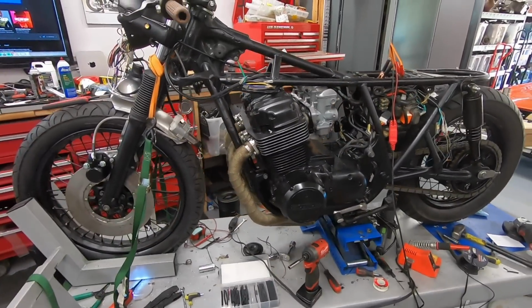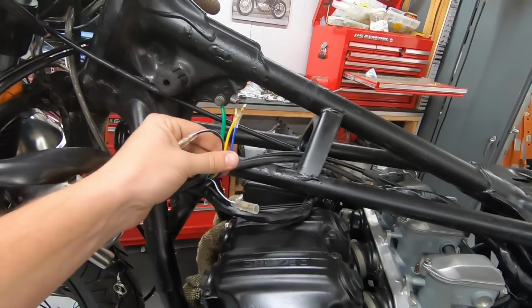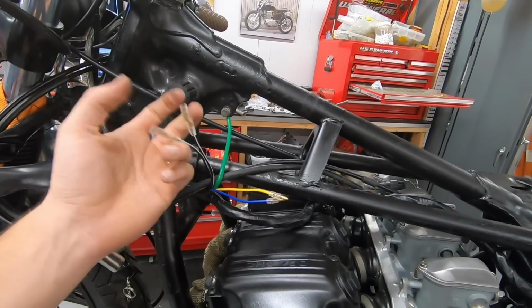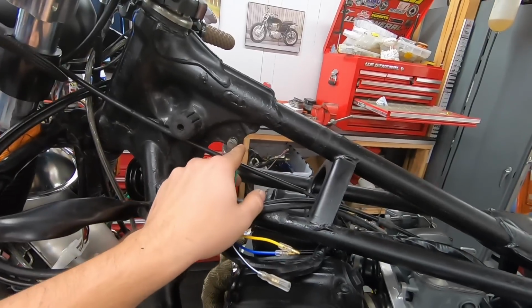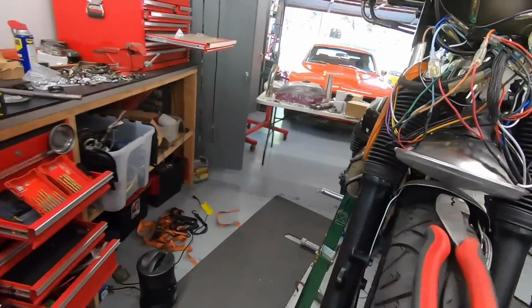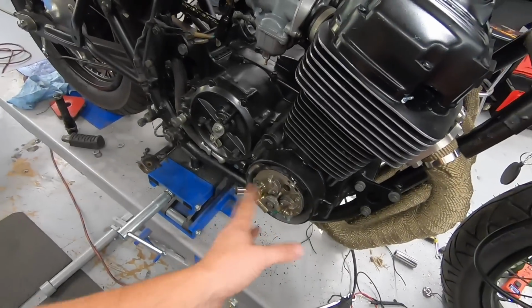The only thing left to wire is gonna be the coils, which is super easy, literally a blue and a yellow that come from the points, the two black with a white stripe for power, and then this is gonna be a more official ground. We are gonna be doing a Dyna S electronic ignition in this bike, so one of the next videos you see on this is I'm gonna show you guys how to install that.